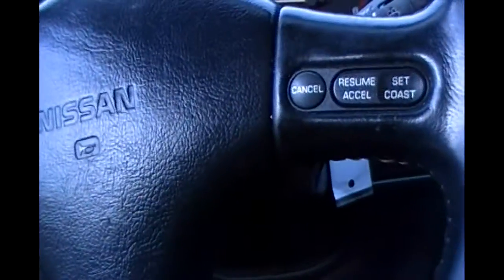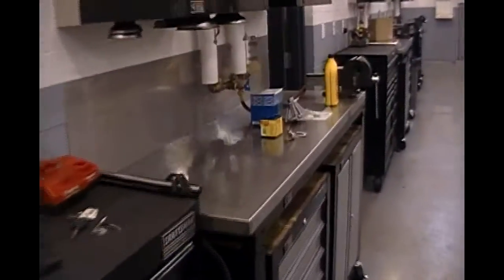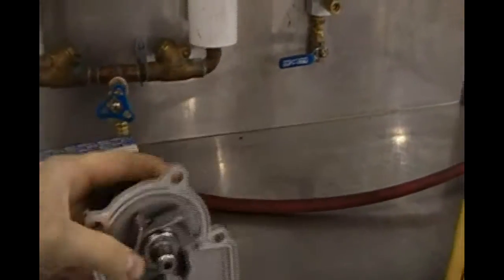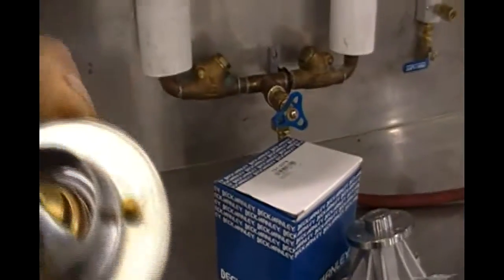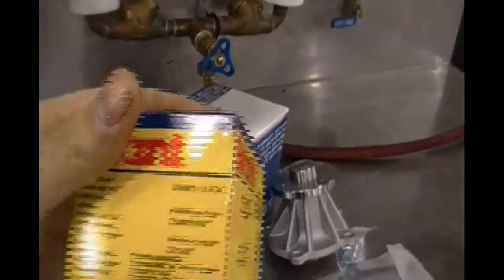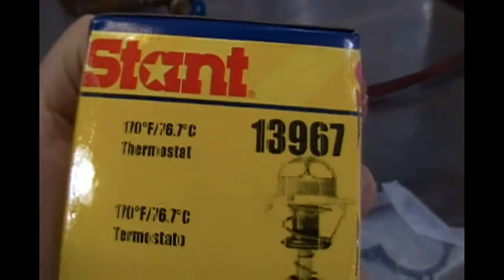Look at that - oh shit, gotta turn that down. I'll probably have to let it warm up for quite a while in order to actually defrost the windshield, so I'm just going to go sit in my truck. Well, we made it - it's a cold ride but we made it. So here's the water pump we're going to be putting in today. My guess is the impeller is gummed up or something - it only has heat in the car once you rev it up. New gasket and a couple of studs apparently. And we've also got our new thermostat. It says 54mm - that's the opening size. We're putting in a 170 degree Fahrenheit thermostat. Let's get started.